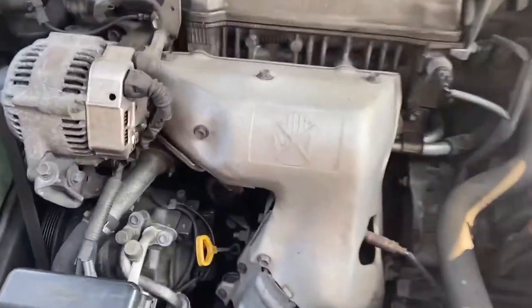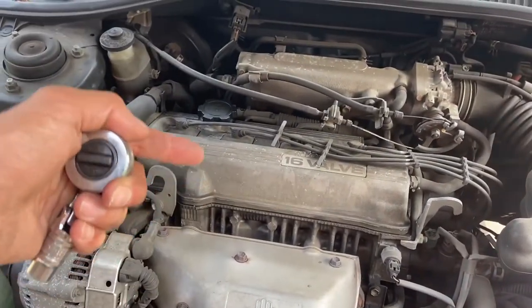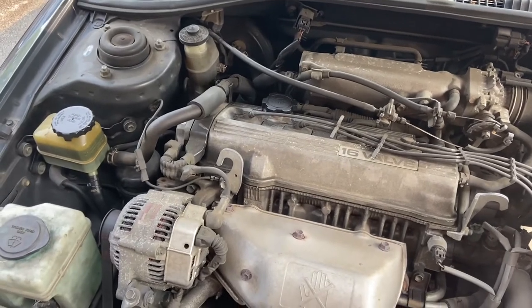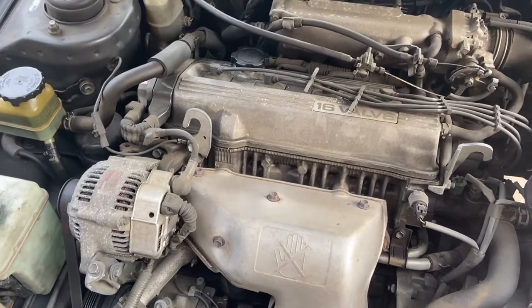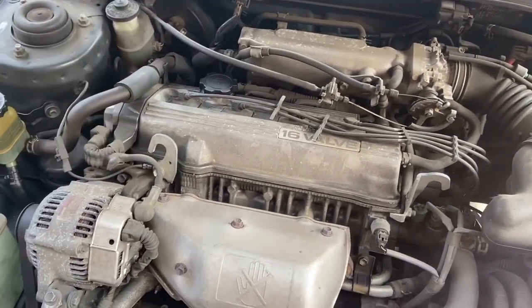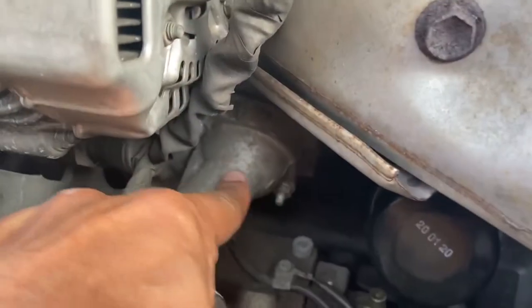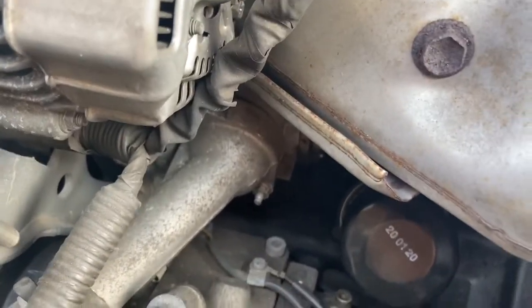This again — I'm not sure if you saw the video of the detail walk around, but this engine is called a 4S FE. We had the 3S FE 2-liter in the late 80s and early 90s Camrys, and then the 5S FE in the 92 through 01 Camry at 2.2 liters. We never got the 4S, which is 1.8 liters. I'm assuming it's the same thermostat as a Camry — a 94 Camry — which goes right here.